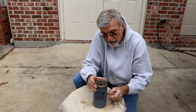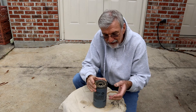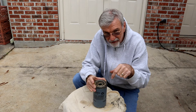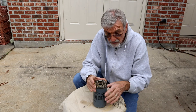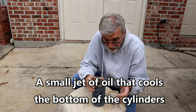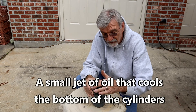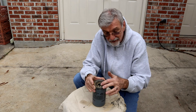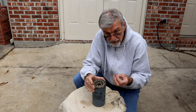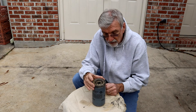When they tell you to fill your filter with oil, ideally — if you really think about it — to stop from possibly getting those little pieces of aluminum that are in the cap of the new oil, which supposedly has caused some plugged up ports in the cylinders, ideally you would put the oil in on the outside here. I never have, but I'll probably try next time. That's supposedly the perfect way. I always make sure I watch very closely when I peel the aluminum off the top of those gallon jugs.